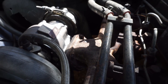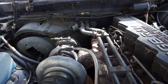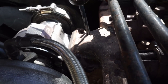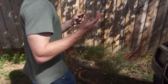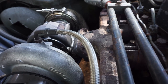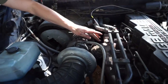There's our dimple. Before we start drilling, we're going to turn the truck on - it's going to help blow any chips out of the hole that we make. Getting a little grease on the tap. You might be thinking it's to help the cutting - it might do that, but what it's going to do is capture most of the chips that are cut when we tap this thing.